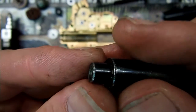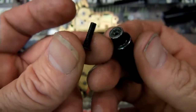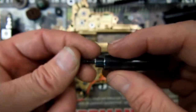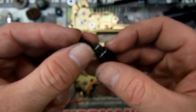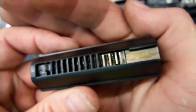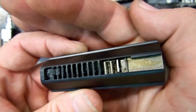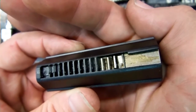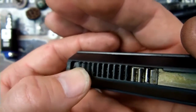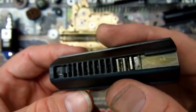There's minimal damage. There's a little bit of galling and stuff on there. I'll polish that up and then clean everything in fuel injection cleaner to make sure that there's no oil residue, and I'll make sure that the threads on this are Loctited so that it actually holds into place the way it's supposed to. Unfortunately, at the same time that came apart, it also caused the piston to break. There we go. You can see the last two release teeth are broke off on it, and probably because it wasn't sitting right, it was catching the wrong teeth when it picked up as well.